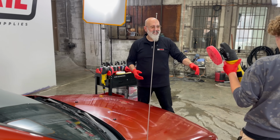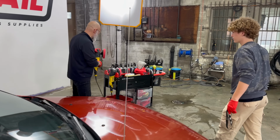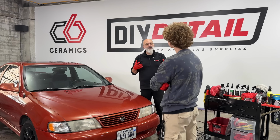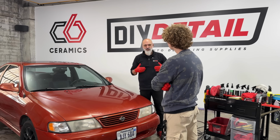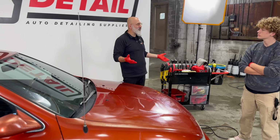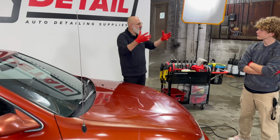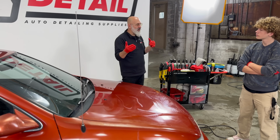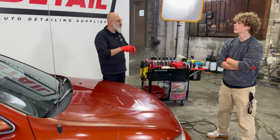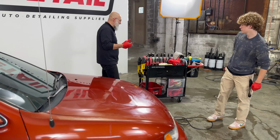Much better. Okay. Now, we have it polished, but we need protection. You don't want to leave paint just polished. In other parts of the world, polishing means a different thing. So here, polish is an abrasive, but you also polish your shoes. And people that polish their shoes, that's something to add gloss. That's a wax, basically. So a polish can be confusing sometimes, but in our case, it's an abrasive polish. It's just an abrasive. So we need protection. It's not leaving anything on the surface.